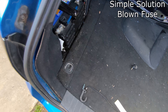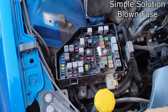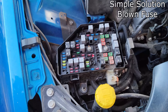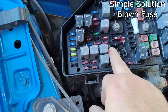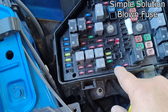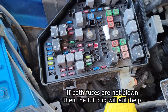The left-hand side taillight doesn't work and he's changed the bulbs and still no difference. He's dropped it off to me to see if I can fix the problem. I thought I'd have a quick look and see if there's any earthing points, and the cover was loose. I went over the cover and found that these two front fuses are supposed to be both 10 amp, but the spare only had a 15 amp, no 10 amp spare. So I swapped the 10 amp from that side to this side — the taillight works. The car has two different fuses for the left-hand and right-hand side.